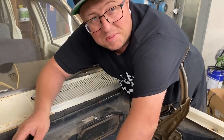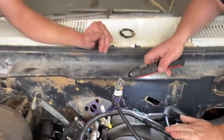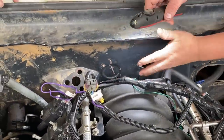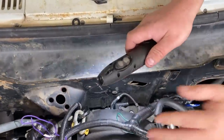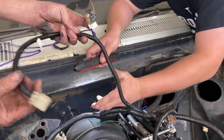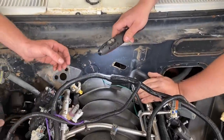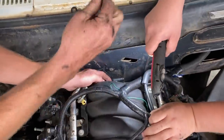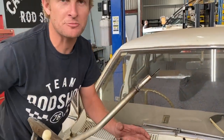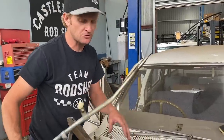It's very tight here at the back of the firewall on the LS in the HT wagon, so I've got Mark in here to give me a hand. We need to feed this bit of the harness down underneath the original wiper motor mould in the firewall — it is a tight fit. We'll start with feeding the transmission side underneath there. The trans dipstick has only just been sitting in there, so we've got to get the wiper motor set up before we can bolt that in.